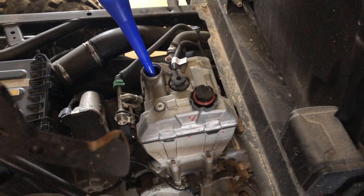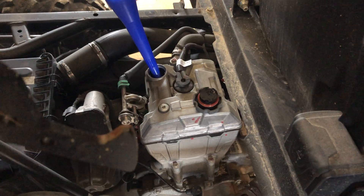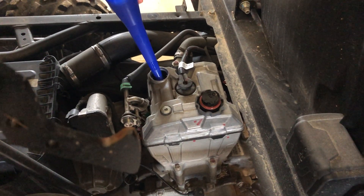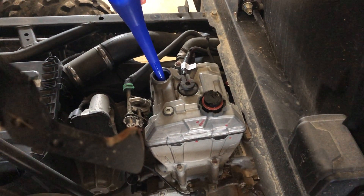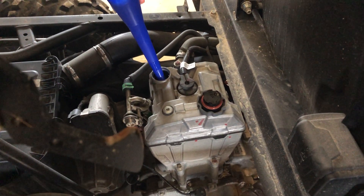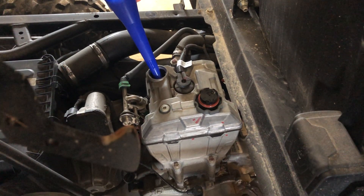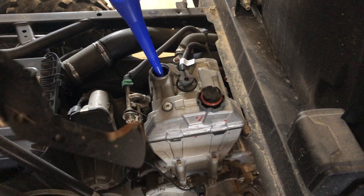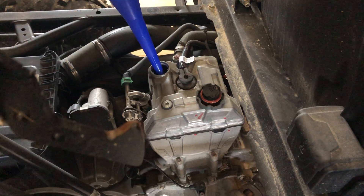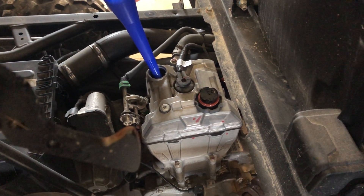The Polaris manual calls for 1.9 liters of oil to be added, which is two quarts. What I do is draw a line on a two-liter bottle. When I get a new piece of equipment, I get a new two-liter bottle and flush it out with whatever engine oil weight the machine calls for — dump a few ounces in and rotate it around.